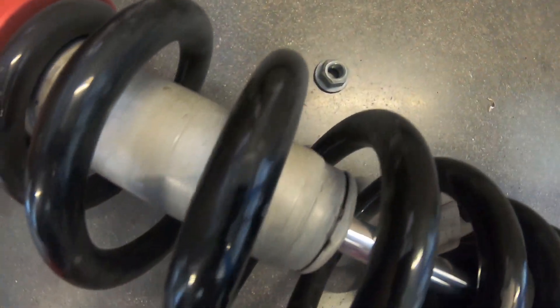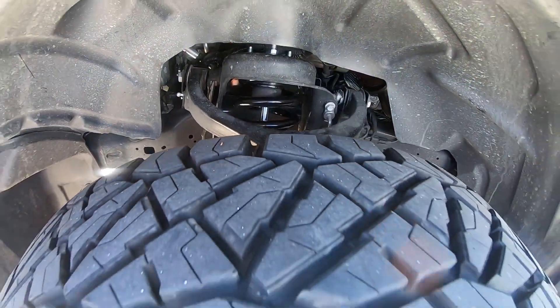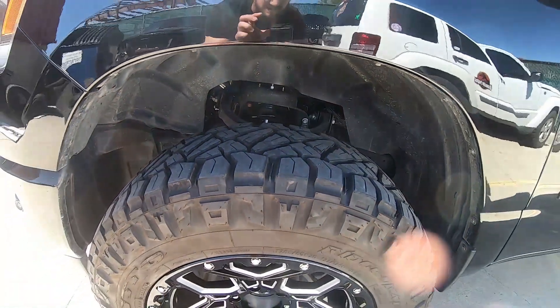When they upgraded it, the coilover strut was a little too thick, so it was contacting the knuckle as he turned the steering wheel. I'll b-roll some of that in to show you the marks from where that happened. We ended up installing the Rough Country strut leveling kit, and it's not contacting anymore.